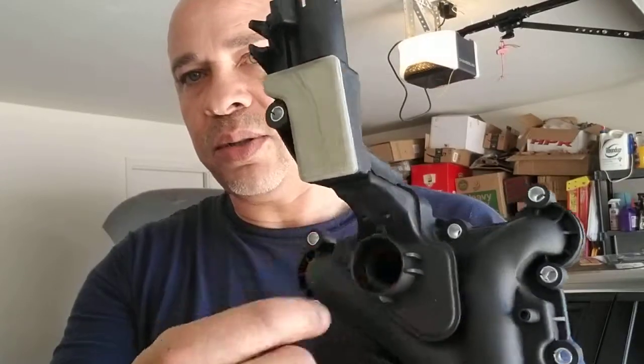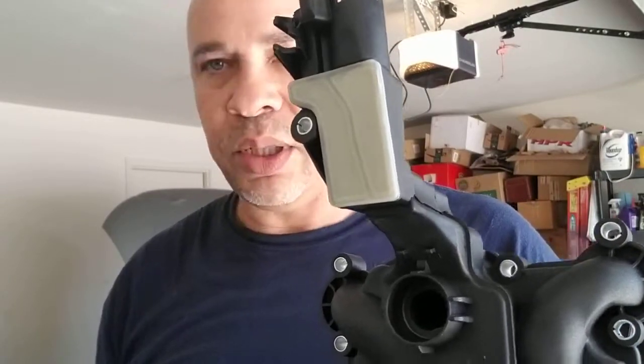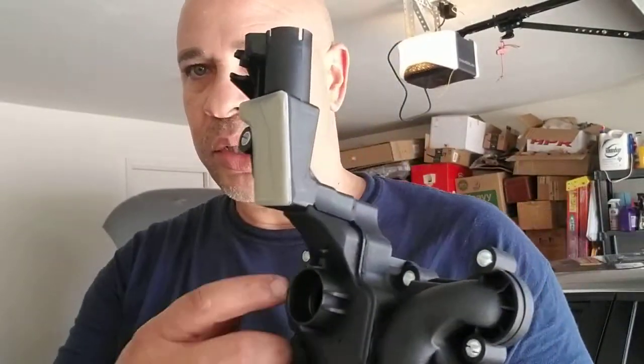And the O-ring that goes inside here, it's the port that hooks up or goes into the supercharger right there. So make sure you get that O-ring out, and either you reuse it if it's not bad. If it is bad, get a new one, put it on there. Should be a standard O-ring. There shouldn't be nothing special about it. Clean the orifice on the supercharger. A little bit of high temp grease, something user friendly, just a little bit, just enough to get it to slide, not snag and rip.